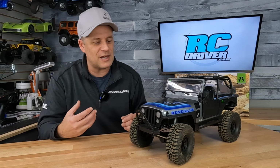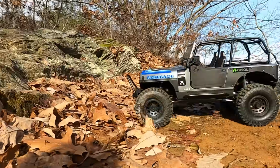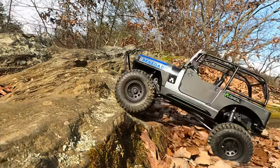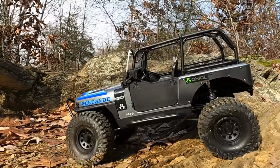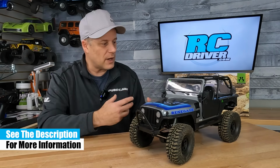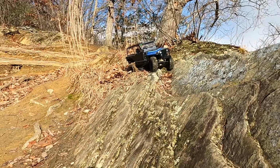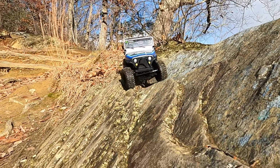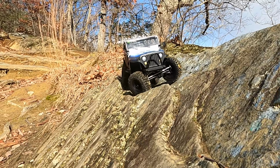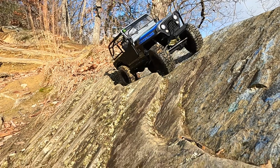The guys that are a bit more into RC, I think, again, you're gonna wanna throw some brass in here. At some point, you'll do a servo and a smoother speed controller motor setup. You're also gonna wanna take that transmission apart and pack it full of grease, kind of quiet down that clicking, but this is a very capable rig. I love this particular version. As I said before, probably one of my favorite of the SCX-10 group, and the tires on here work well. The rig just looks good overall.